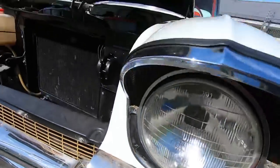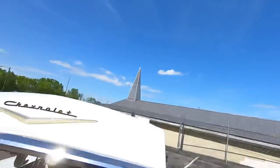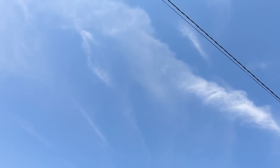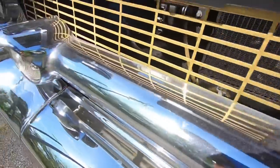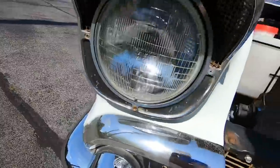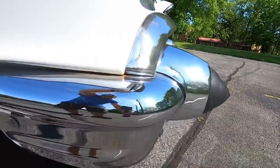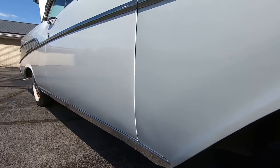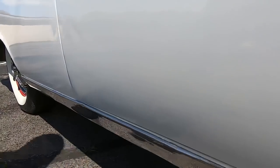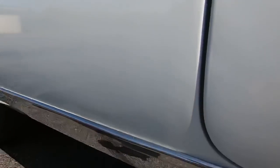The little trim piece here has got some pitting and scratches on it. You've also got some pitting popping up around the headlights. Lots of little pitting on the front trim pieces above the main bumper itself. But it's in good shape coming down this side. You can see it's got some body work down at the bottom — there's a little bubble popping up there. The bottom of the door looks solid, pretty good. Slight dents in this area.